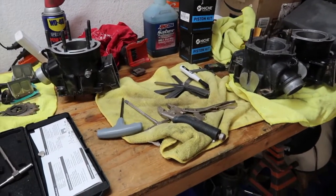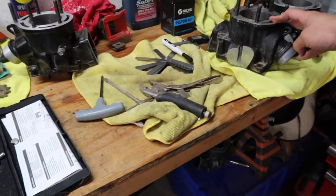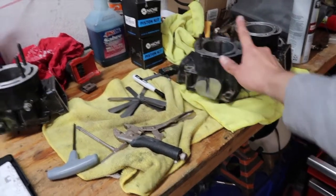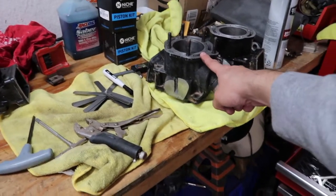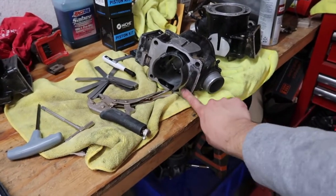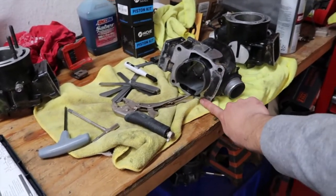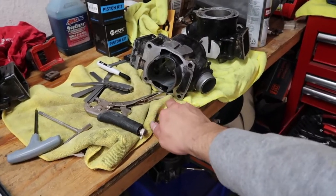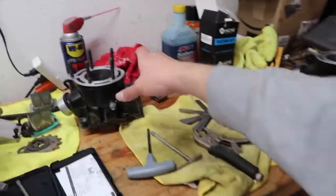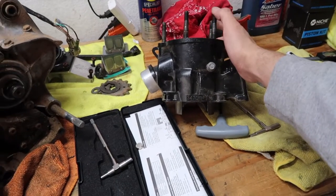Maybe I didn't. Well, it's not my fault. Well, it is my fault because I didn't measure the cylinders right. So if I didn't measure the cylinders right, then that means the pistons and piston rings that I ordered were wrong. So I originally was trying to use the old cylinders, the old jugs, and they have the water plug already, which I wanted to buy new anyways, but I was just going to put them on with a little bit of sealant with the gasket, and I was pretty sure it was going to hold. But now, since the pistons aren't working and we're going to use the new jugs that came with the Banshee, the top end that the guy gave me, I was transferring over the head studs.